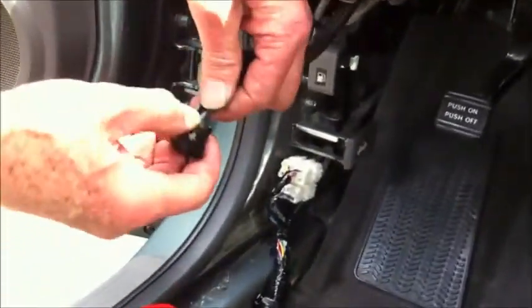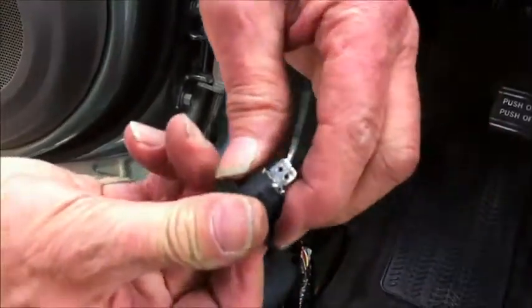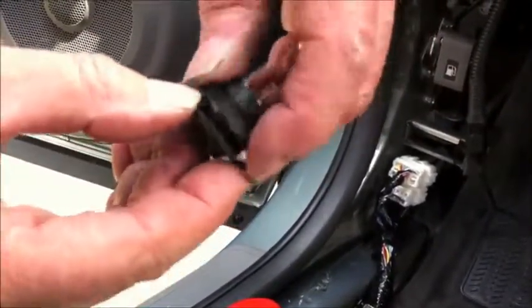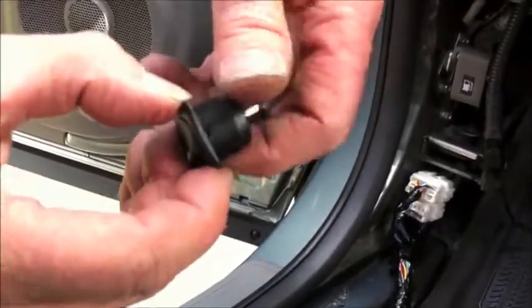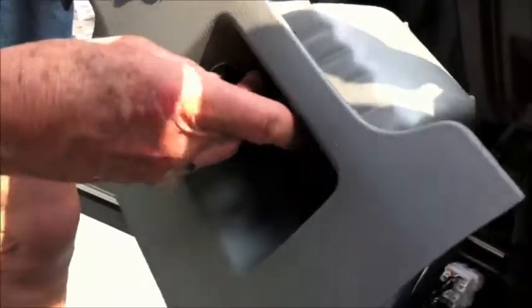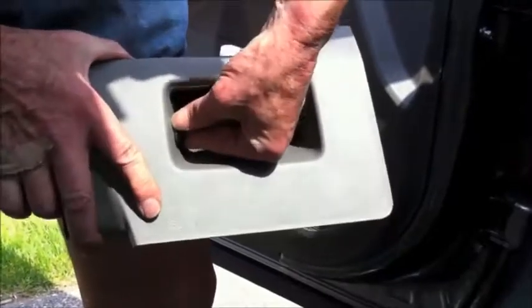Now, on the switch itself, we remove the two contacts by pulling on the connectors so that it comes loose, and then we spin the switch mounting nut so that it comes off. And then we're going to take the panel and we're going to blow out the remainder material, and we're going to mount it. And we recommend that you mount it with the white dot up. So we need to make sure that when this panel is installed, which is actually going to be in this fashion, it's going to be mounted with the white dot up.